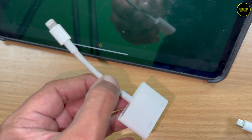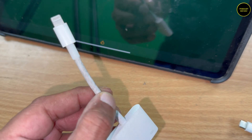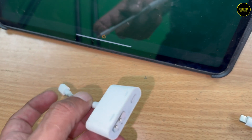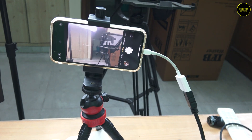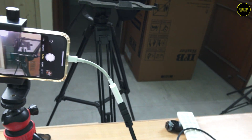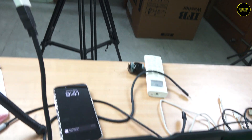If you have an iPhone with a lightning connector, then connect a lightning port dongle which has an HDMI out to the iPhone. Use any regular HDMI cable to connect from the dongle to the capture card, and the rest is the same.